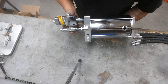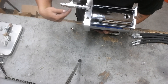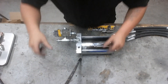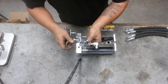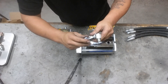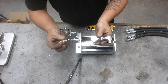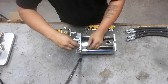So this is the way it's going to look: your 90 swivel, check valve, T straight, dump, plug, and straight fitting. Now that this is all assembled, you're going to work on the slowdown. Your slowdown is what controls your fluid. So if you drop the car down when you first build it and it drops too fast, just turn your slowdown clockwise. If you go counter clockwise, you're opening it up. Normally I always start by closing it. So it's going to be 3/8 pipe into the slowdown.